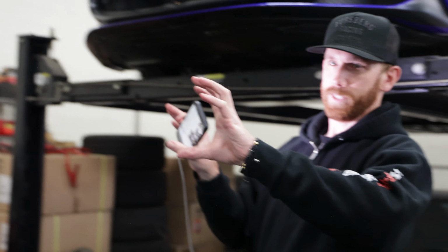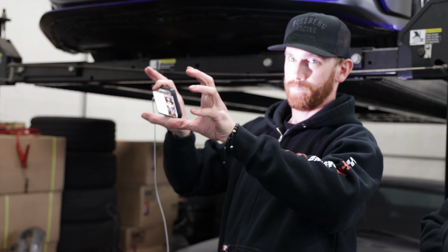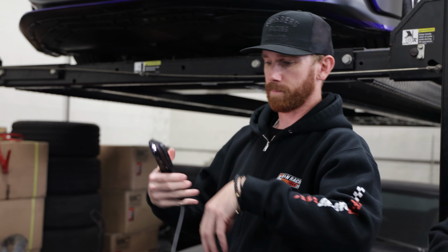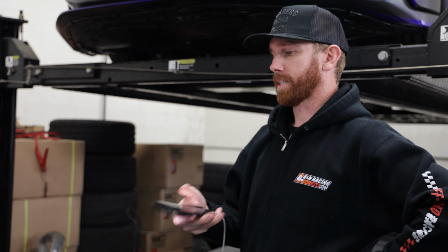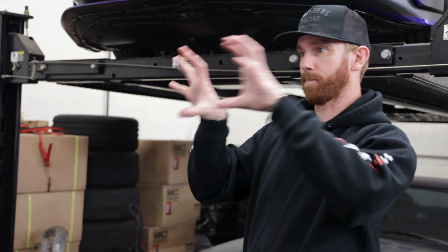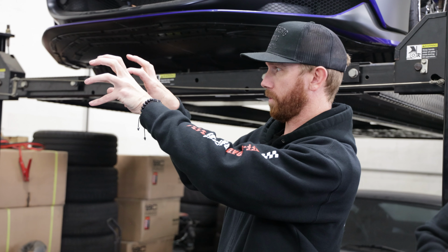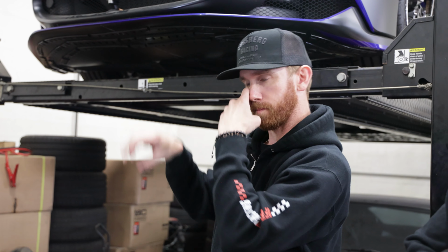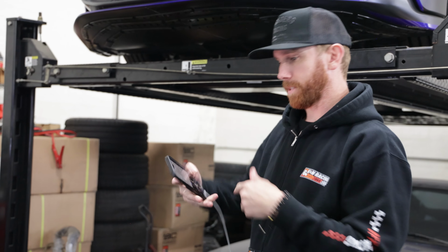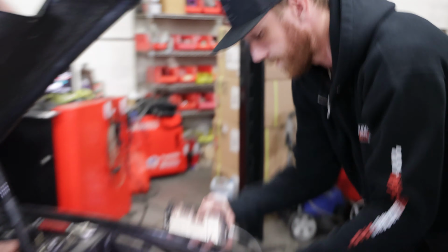What if it's off a tooth on the crank? Yeah, that's why we need to put it at TDC. If everything is advanced, then we'll do something. But no, I'm saying in the timing chain. Even if it's at TDC and the cams are phased together correctly, they could both be forward. Based on all these photos, it looks like they're both forward, because the lobes should be even to each other.